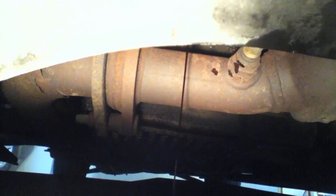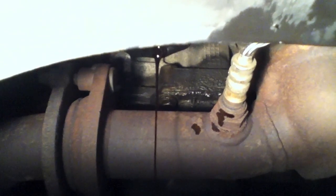And now you have a steady stream of oil dripping down, missing everything and going right into your drain pan. And after it's all empty, you can unscrew your filter. There's going to be a little bit of residual fluid in there that's going to drip on a little bit of stuff, but it'll make a lot less of a mess.